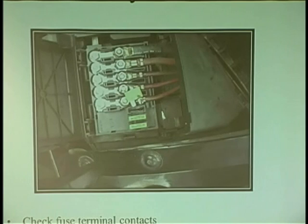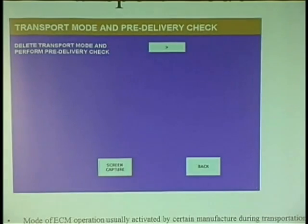And you know what? I remember years ago, what the heck was that? Was that a Volvo? They had these fuses that were in the panel, and you had to take them out and put them on emery cloth just to clean both ends, and then clean out where it got tension, and the tension would lose on the fuse. So you had to go there, clean, emery cloth it out, then you had to push the fuse holder back together and slop it back in. Fuses were big problems. So connections with fuses is a big problem that we overlook all the time.